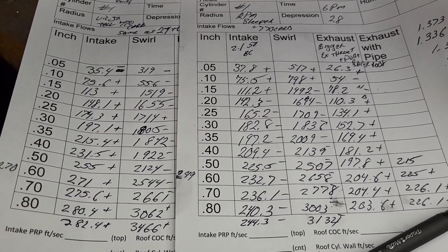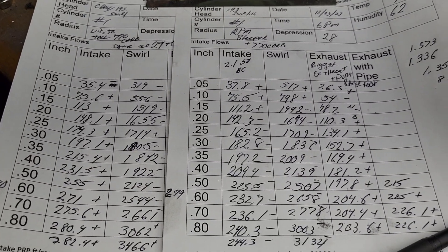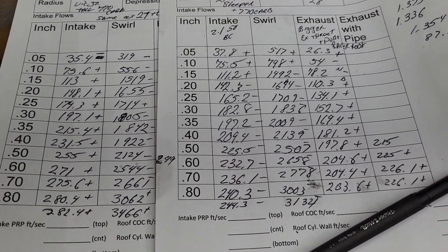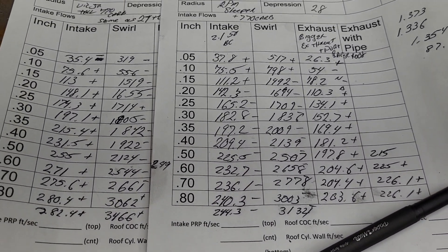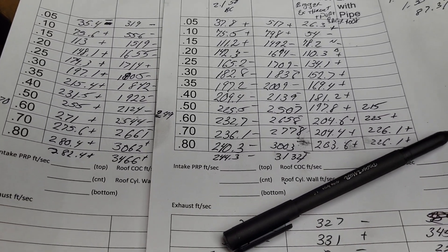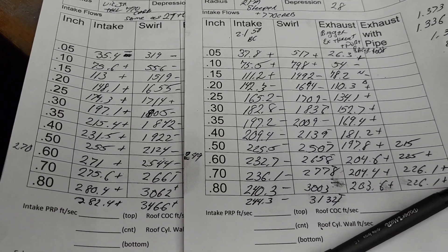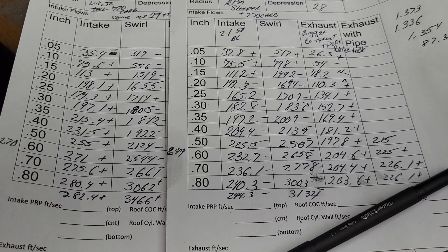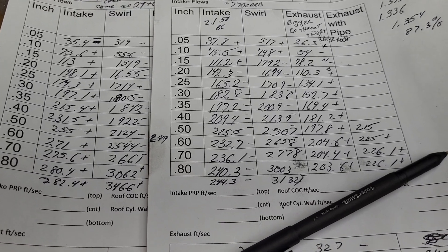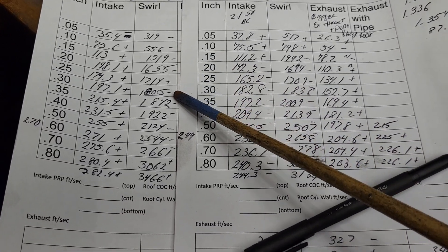The RPM requirements between super stock and this will be a little different, so you have to figure that into the equation. In any case, it's the worst cylinder head in history — just figured I'd put that out there. Our swirls are quite interesting because even though the ports are still coming in from the same direction, they're different sizes, shapes, and tapers, so they are going to affect swirl. How do we do? Minus, minus, minus, plus, minus, minus, minus, minus, minus — until we start to lose it on the short side.